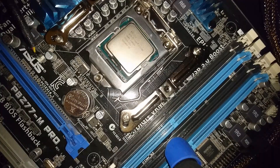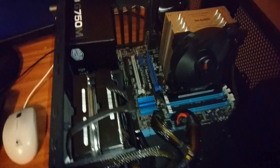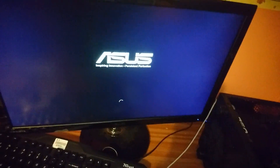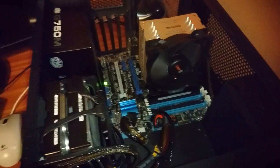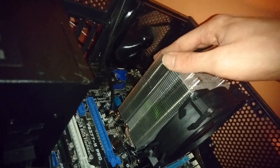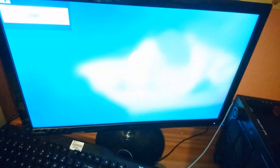That's now finished. Just so I could test the PC quickly, I put the CPU cooler with some thermal paste on the CPU and just held it in place while I switched the PC on. That's fine for a short amount of time, just for temporary testing. I didn't want to put all the computer back together again just in case it didn't work, and I'd have to keep taking it apart. So I literally just placed the CPU cooler on to see if the computer booted up, which it did — so I'm really happy that it worked and managed to boot into desktop.